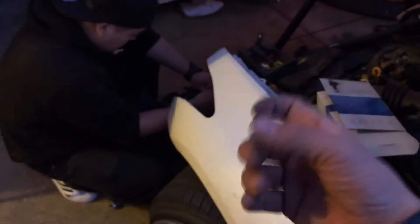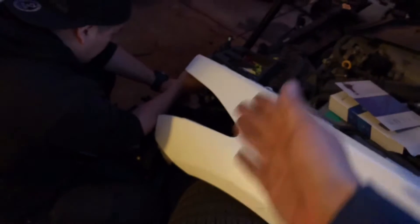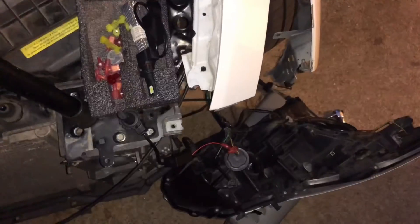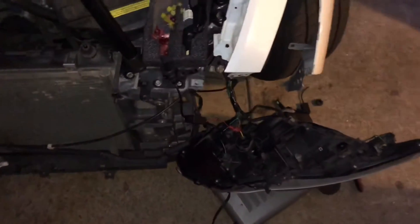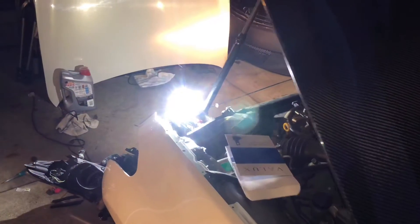George is working on the wiring. We have it on auto right now, trying to see what works without having to use the fog light switch, so that'll turn on the LED. It's really weird how it's not working the way it should, like I did with the G35 headlights, but at least we figured out a way to turn them on. It's getting pretty dark now — wire it up, connected, red with black and black with yellow. Start it up and see if it will actually turn on. There you go — now it turns on perfectly fine. This one disconnected the fog light and connected the LED to the fog light circuit. We're gonna do this one next, put it all back together, and take it out to the gym tonight.